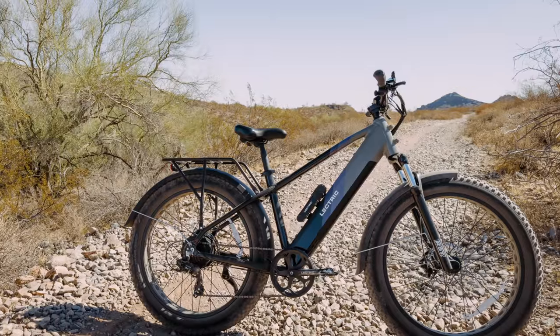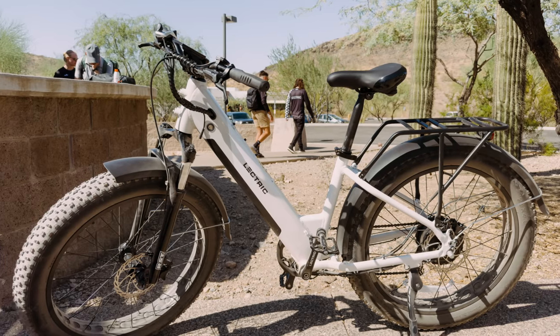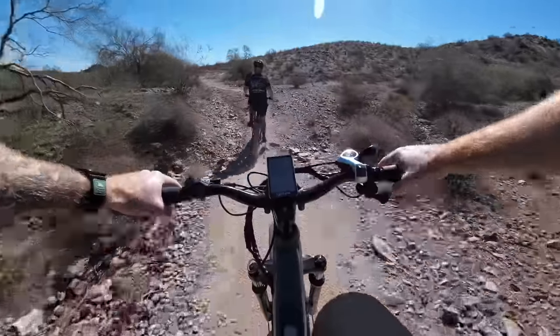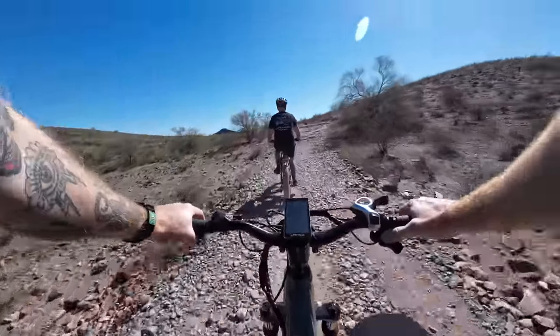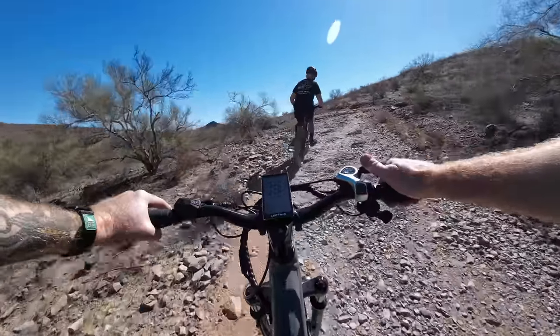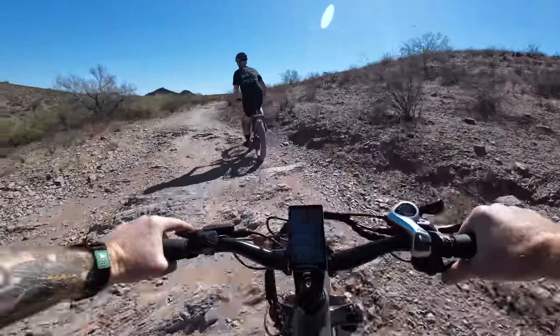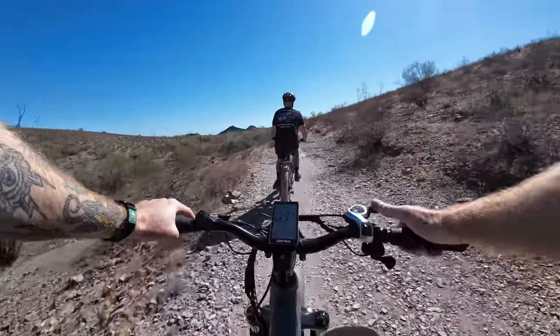The frame will be offered in two different styles: a high-step and a step-through, in one size with the colors you'll see on the website — white on the step-through and black and gray for the high-step. It does have that ISO 4210-10 EMTB certification for safety, so the frame, fork, stem, and handlebars have all been tested to withstand a crash and keep the rider as safe as possible. Additionally, it has the IP65 weather rating, so it's very much capable of riding year-round in all sorts of bad weather.